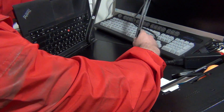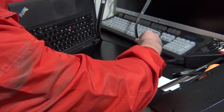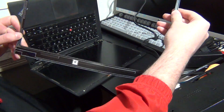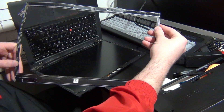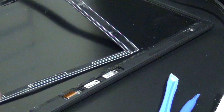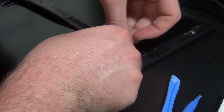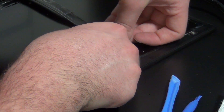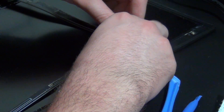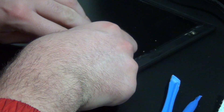With a bit of patience, the bezel will slowly work its way off. Once you have the bezel off, find somewhere you can lay it flat with the back of it facing up. If you were lucky, all of the adhesive strips may have come off with the bezel. However, sometimes a few of the strips will stick to the inside of the display assembly. You can see on the bezel that there are several outlines showing where each adhesive strip should go. So if any strips didn't stick to the bezel, carefully remove them from the inside of the display assembly and press them down onto the outlined areas. Try not to let the strips twist or fold, or the bezel may not stick back on correctly later.